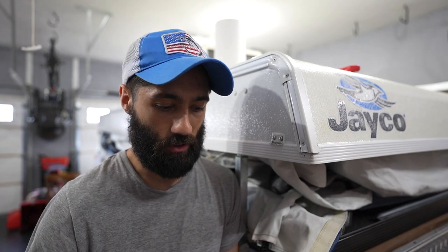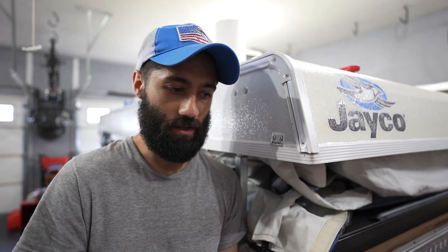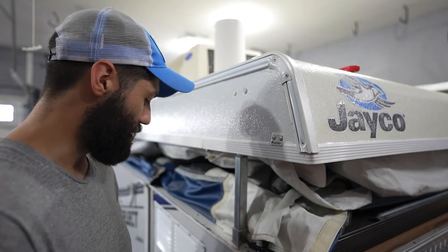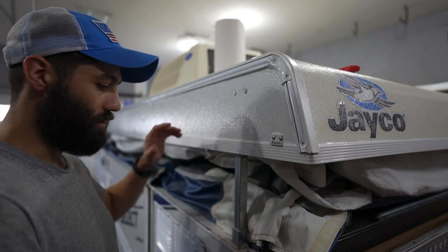I hope that gives you the confidence to waterproof anything on your pop-up camper, whether that's the roof like we showed in this example, your box corners, or essentially anything that would otherwise compromise the integrity of your pop-up camper. It could be where your power cord comes out, your refrigerator vents, or the roof clasps on the bottom — it's all the same thing. Just make sure you're using butyl tape and caulk where appropriate and you shouldn't have any problems going forward. Hopefully you find this video helpful, and hopefully we see you in the next one — or out there camping.